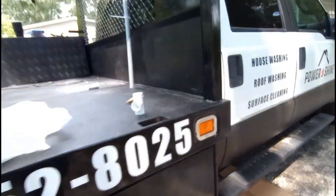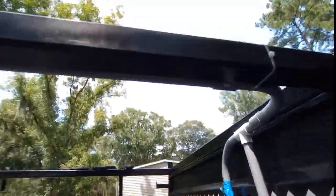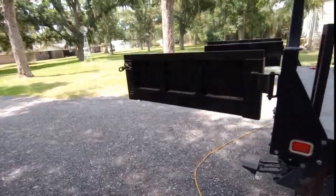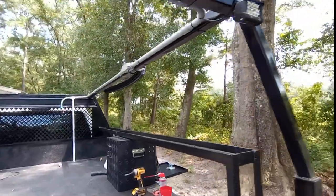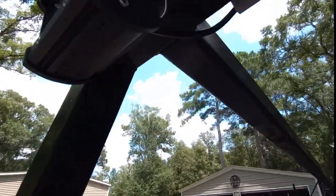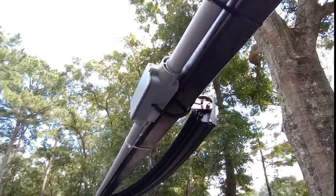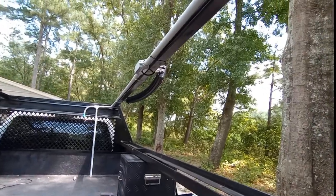That just runs all the way over here. It just comes down, there's a 90-degree fitting and it goes all the way back. It runs to this junction box here, which I showed you earlier, and comes over to this light. I might shoot some silicone in that hole — same with this one, silicone it. Then it'll be a watertight system for my electrical.